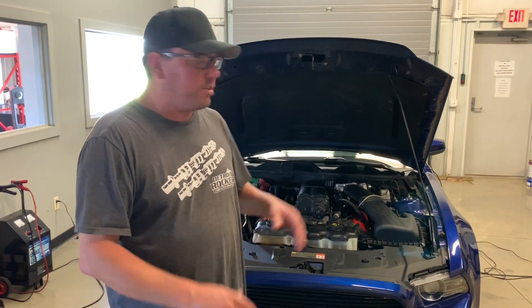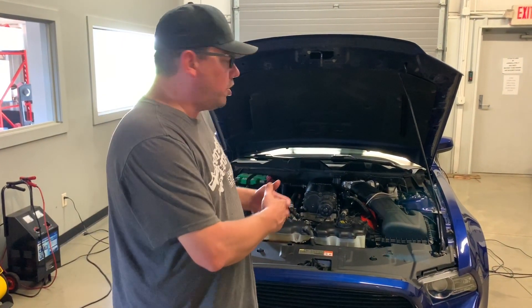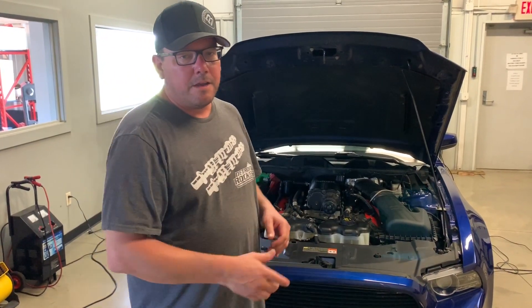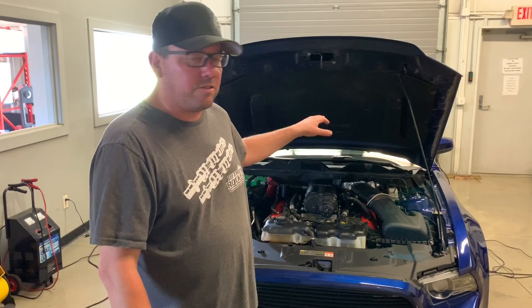The reason I'm excited today is this is a 13 GT with our 650R package, and it is one of the original mailer packages that we developed using the Roush TVS 2.3 liter supercharger. We're going to do a dyno pull on the car. I'll come back and show you some of the other mods. Basically it's a mild car — came in stock, Roush supercharger, some exhaust, some cooling mods. I'll leave a link in the description with all the parts. You can email quote@brinspeed.com to see how much something like this costs to get installed. Let's watch this dyno pull.